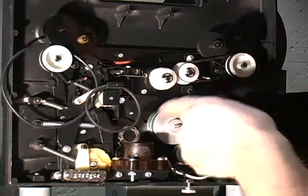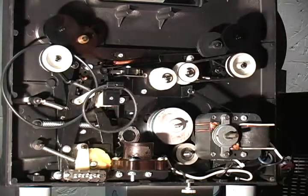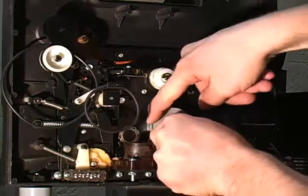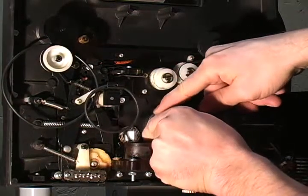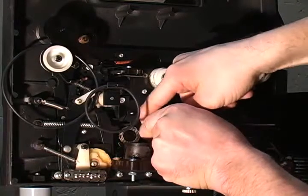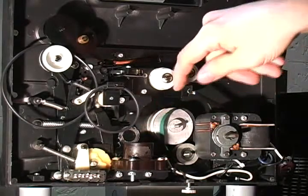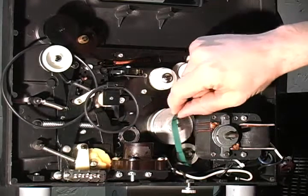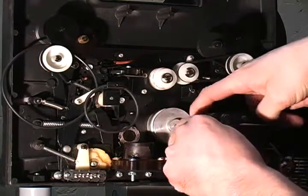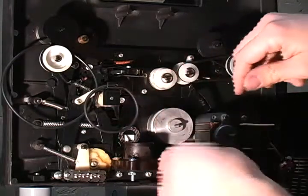Now that we have this pretty much exposed, this next part is a little bit tricky, but it's pretty simple once you do it a few times. You just want to get it started — you want to start working this one pulley up as you're grabbing hold of it with your hand, and you'll see that once you do that it's going to start up just like that. Then you just keep working it — it's real easy. Boom, it's off. The tricky part, if you're not going to take the motor off, is getting it past this other pulley. I just turn it on its side, bring it down, and get it out of there just like that.